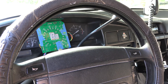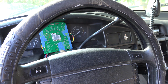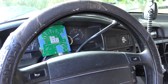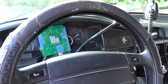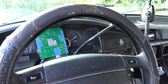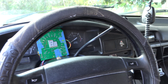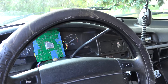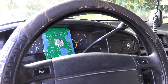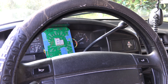All in all, not a bad test. I've successfully hooked up to the signal coming from the PCM to drive the tach - just got a little bit of a calibration issue. I need to do some more research to find out the exact frequency-to-RPM signal coming out of that PCM. Other than that, I think we're good to go - a couple things to fine-tune and that's about it. I just want to thank Mr. Raylan for letting me borrow his truck for the day to test this thing out. Thanks, Raylan.